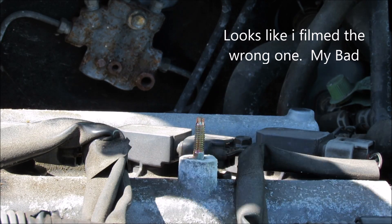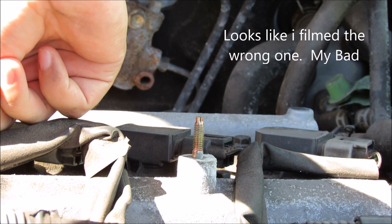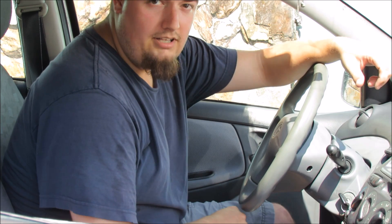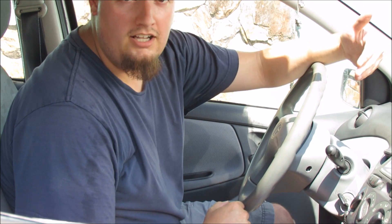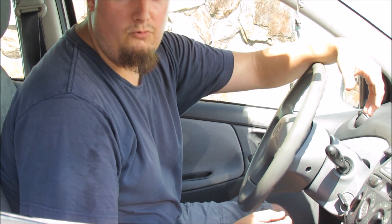What we're going to be doing is pushing down on the end of the connector, slightly prying up with the screwdriver on the other half, and then pulling it straight out. The reason you may need some assistance is because you may have to have the car in gear to make sure the coil pack misfires. In my example it doesn't really work when I'm in park, but when I'm in drive or reverse the car will start to shimmy. Let's go ahead and start the car and see if it gives us the issue.